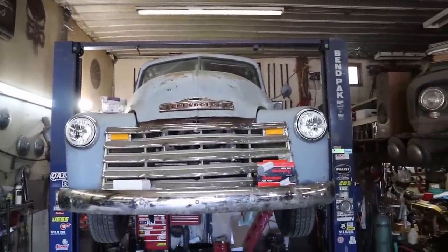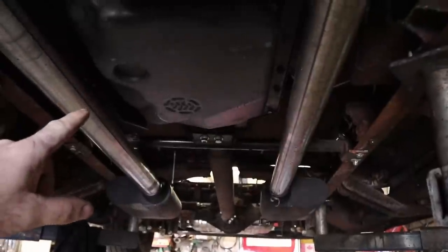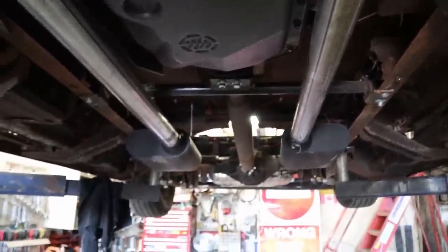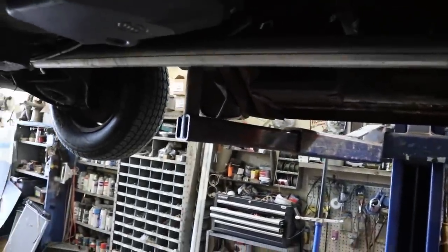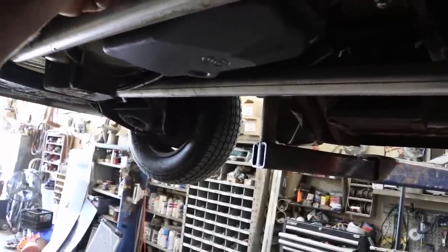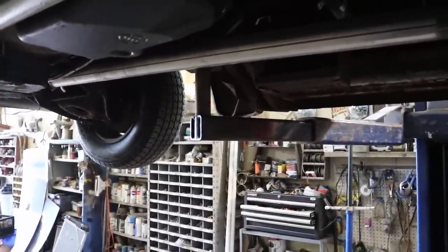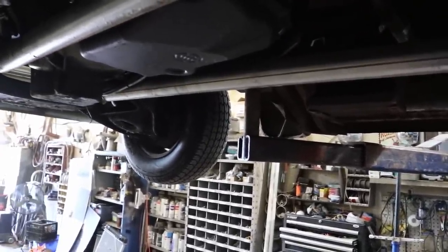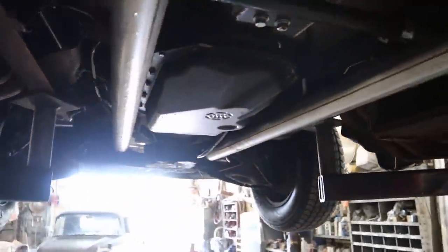Okay, we got this sucker back — well, she's on the hoist. I'm actually bummed this doesn't have a drain. I thought all these EDs had a drain plug, I guess not. Anyways, the tranny's not working. I know there's something weird with the plug here, so I'm going to pull the pan and see what's going on. It's like the pins — something sketchy going on. Somebody had ripped the plug off when I got it, so the pins were bent. I'm going to drop the pan, have a snoop, see if I can find anything weird going on inside, and if that's maybe why the tranny's not working. And if that doesn't work, we're going to pull the transmission out.